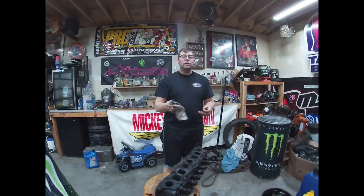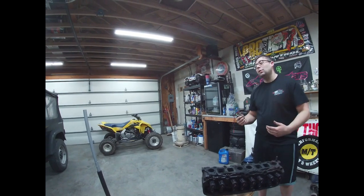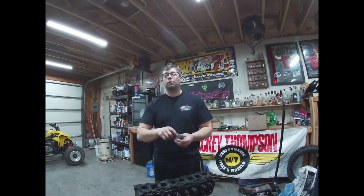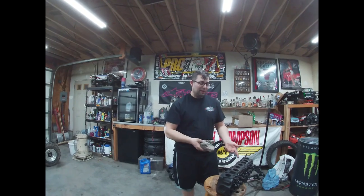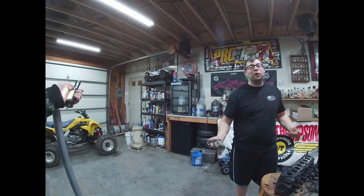Oh, for sure. Especially if you're really getting at it. And we've been taking our time, talking, watching movies, videos, YouTube. And actually, a big problem with these things is that manifold bolts actually back out. Like Chevys and all that, you hear people with the LSs and the older 90s 350s, you're always getting bolts just snap off, man. But these things, they're backing out for you. They're already loosening themselves. They're ready for you.